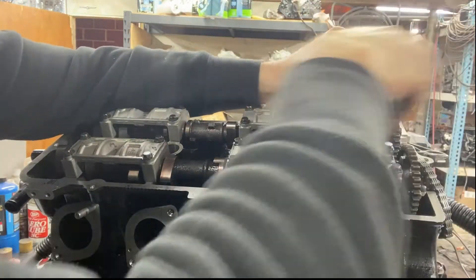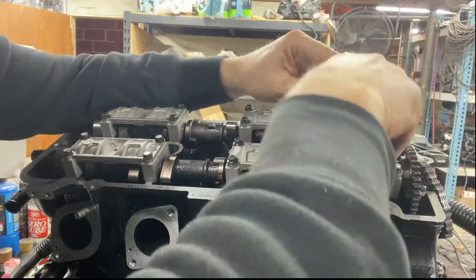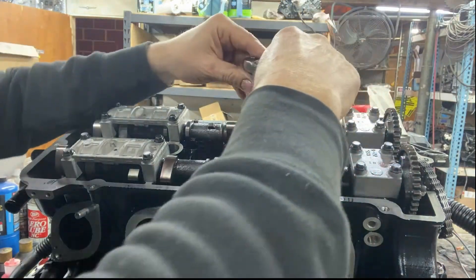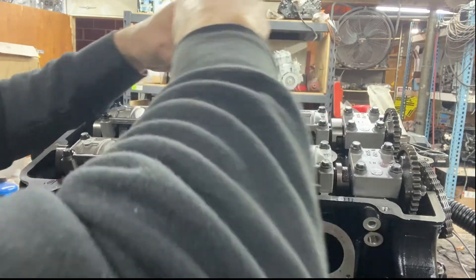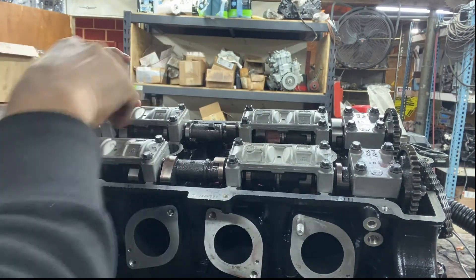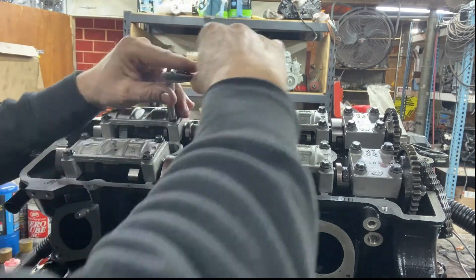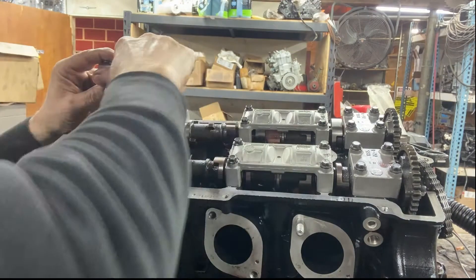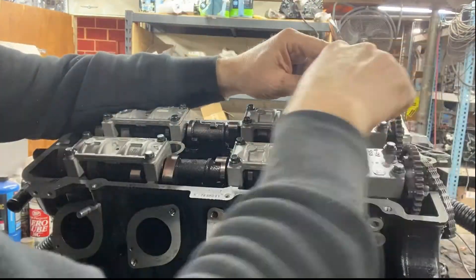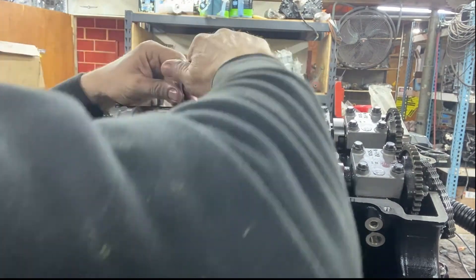The guy comes back a couple years later and the rust was severe - definitely not from that year or the last. We had to bore the engine 30 over because of how much rust was in the cylinders. I couldn't get them clean at 10 or 20 thousandths over, so we had to go all the way out. It was a real mess. Moral of the story: if your boat is in heated storage and you're not picking it up for a while, do not leave the keys. This repair is going to run him close to $6,000.